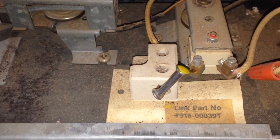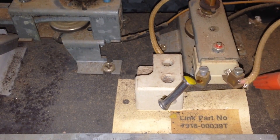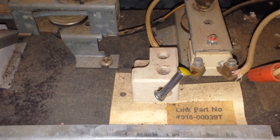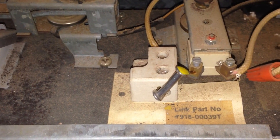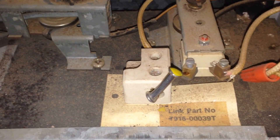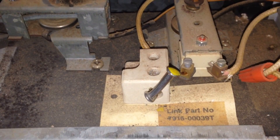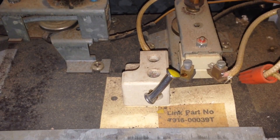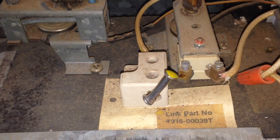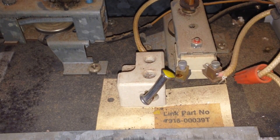This is the new fuse installed. The sticker indicates Crada's old part number for the fuse — they've changed their part numbering. You can find the list of part numbers easily enough online, and find the fuse for your model there. The 79161 uses a 177 degrees Celsius fuse. Any fuse rated at about 15 amps, 250 volts, and the appropriate temperature should work.